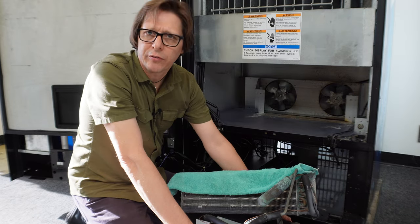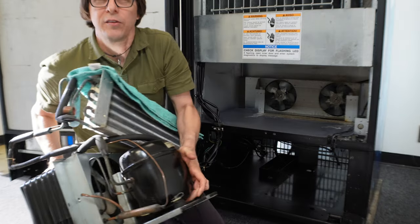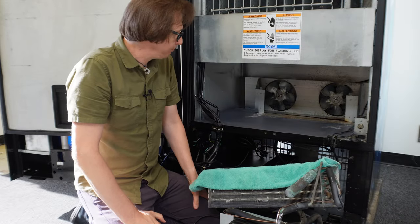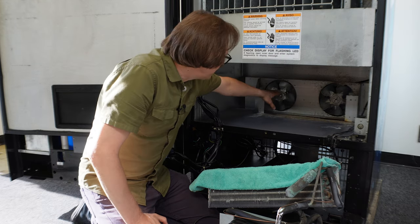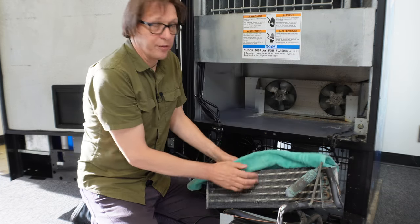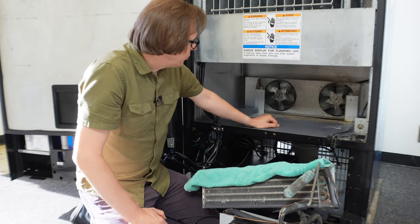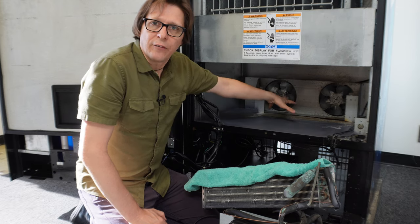When you're grabbing the compressor, be careful — the back of the unit may be hot. This little piece right here gets very, very hot, so be careful when pulling it out if you just recently unplugged the machine. As you can see inside here, we've got two fans. A lot of times these fans will stop turning, and with no air circulation, the coil will freeze up completely. This machine has two fans; sometimes there's just one right in the center. This makes it a lot easier to get in there and change out those fans if needed.